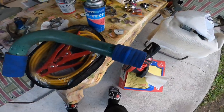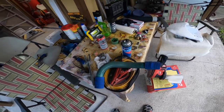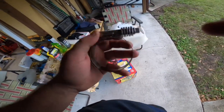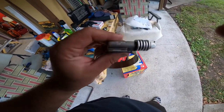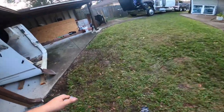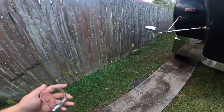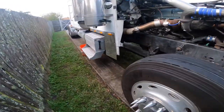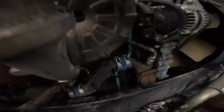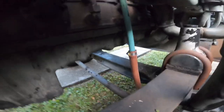It went from being nice Detroit green to messed up when we were putting it on. We noticed the clamps I had gotten were small - the guy at Freightliner sold me a 200-series clamp but you need a 250-series clamp, so just note that for anyone who wants to know. The breather is now on with the clamp - you can see it coming from the bottom. The new breather hose is brown, I guess that's just how they come. Here's our little drain valve installed.